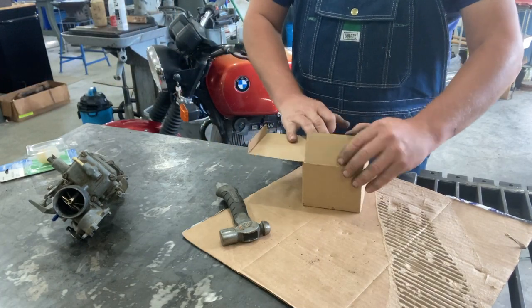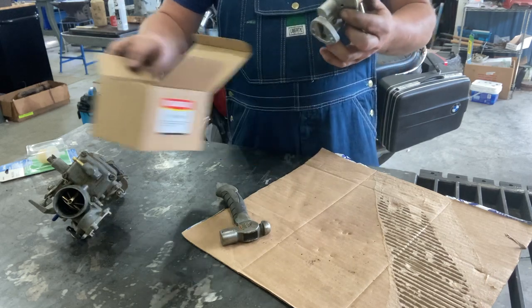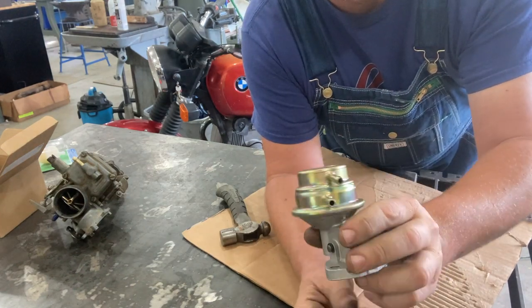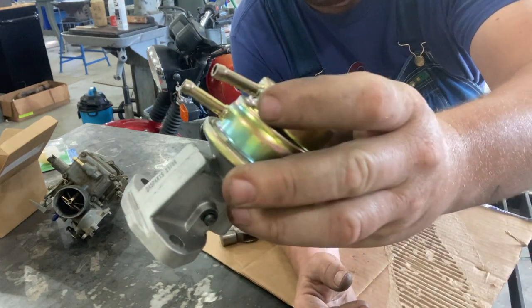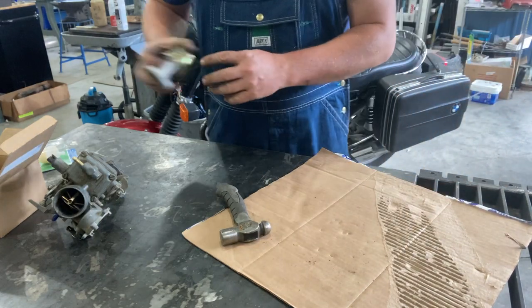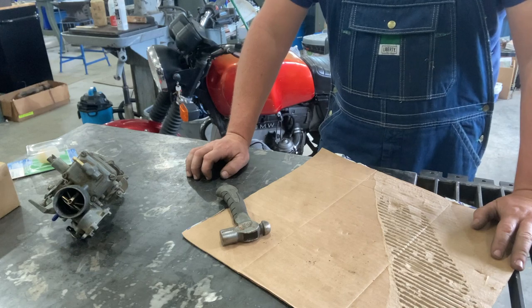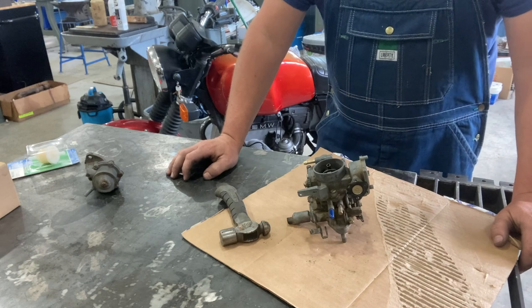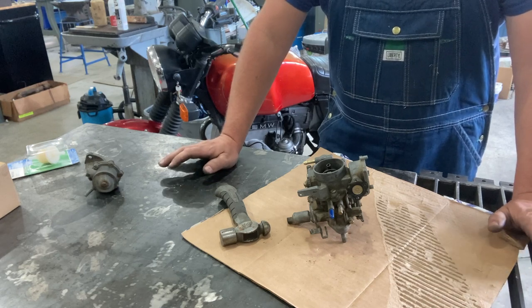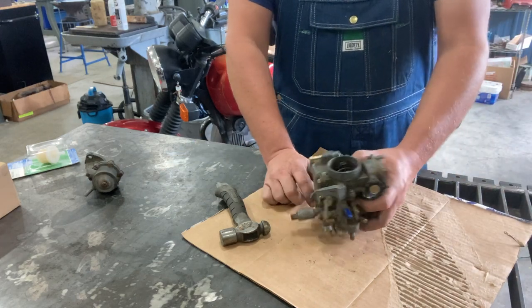On the fuel pump outlet, you're pushing away, so if anything it's going to try to seat the hose further back, but they can still come off — so keep an eye on those. I also ordered a fuel pump from Das Parts — never used it, don't know if they're a good company, leave a comment if you have. The fittings on this one can't pop off, which is probably a good thing. I'm a big fan of mechanical pumps anyway; I don't think electric pumps solve anything. There's a lot of talk about vapor lock, but I've run these air-cooled cars everywhere from northern Maine down into Mexico, in heat and cold, and I've never had vapor lock problems. I don't think vapor lock is really a problem in the vast majority of these air-cooled cars.